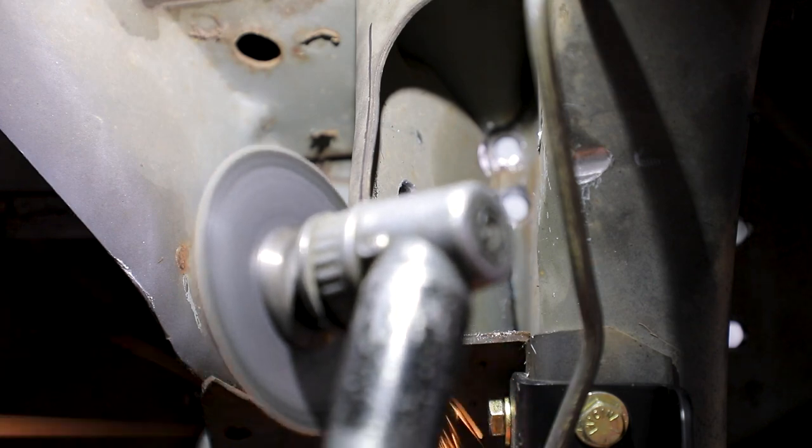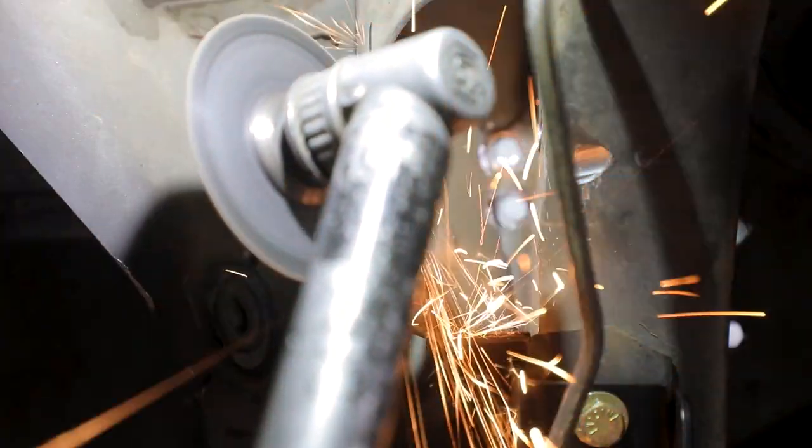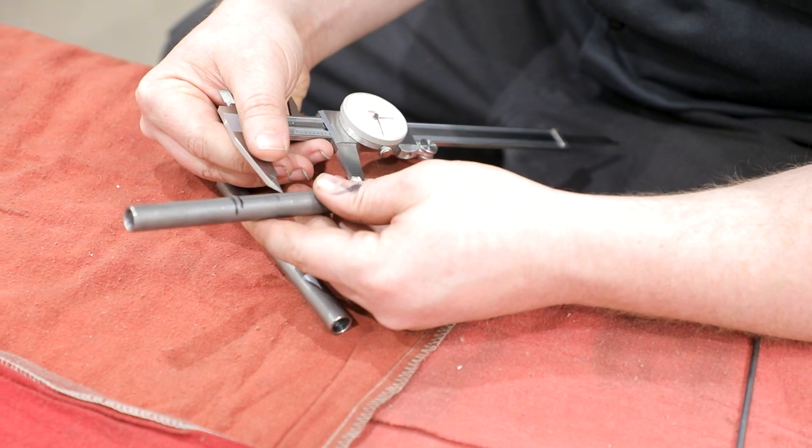You may need to trim the outboard side of the factory trailing arm pocket to allow the swivel link brace weld assembly to fit properly. Locate all four of the 1/2 inch OD by 5 inch long crush tubes.